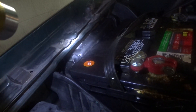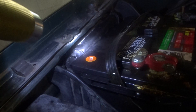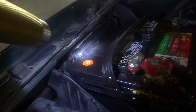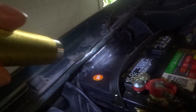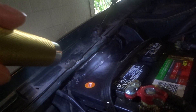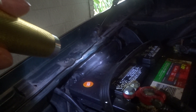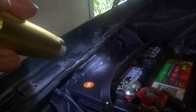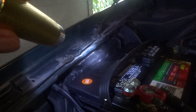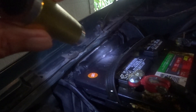The leaking vacuum canister was causing that intermittent AC going off. What it would do — I found out — is when you mash down the gas, that's when the AC would quit working. It's taking energy from the AC to run something else, so the AC was temporarily cut out. Once it got off the gas, it started going smooth and cool just like normal.